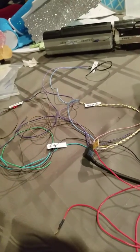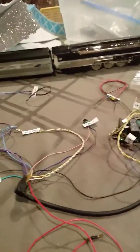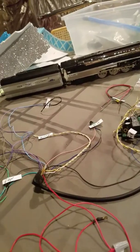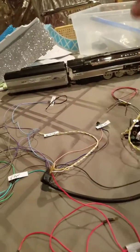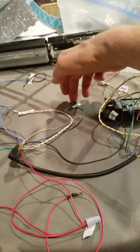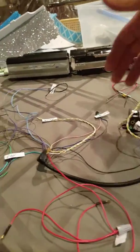Now the computer inside here can not only count the stripes, but it can also determine the time, how many stripes were passed, so it now can determine speed. So with the tach and the stripe and the controller and the program inside the controller, we now have cruise control or speed control inside the engine with just that piece.